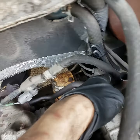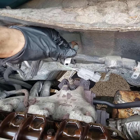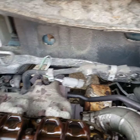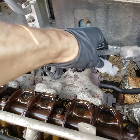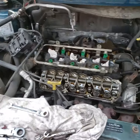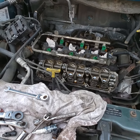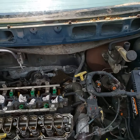Down here at the bottom there's gonna be two bolts in the back of the intake held on by 10 millimeters. You'll be able to see them once you loosen everything up — that harness will be stuck back there, and there's a clip for the oxygen sensor that's gonna be back there too. 15mm, 13mm, 8mm, and 5/16 are all the tools you're gonna need.